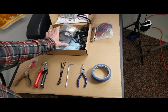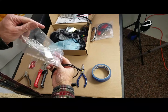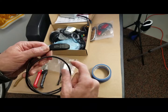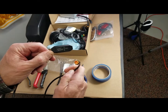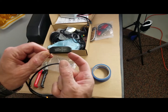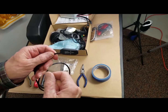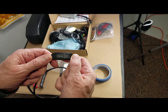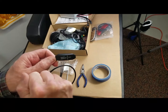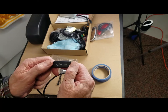So I got my handy dandy box of goodies — this is what a shift sensor looks like. A simple little sensor that plugs into your mid-drive controller. It basically senses the cable movement inside this unit, sends a signal to your controller, and pauses the electricity — pauses the power to that motor for a duration of time, about a quarter of a second — just enough to take that power off and allow a smooth shift without tearing up gears or breaking chains.